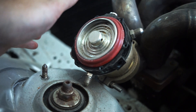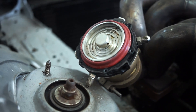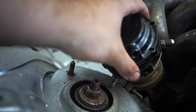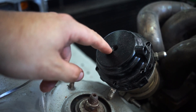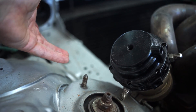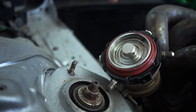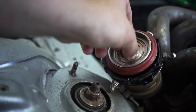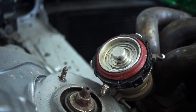Because you don't want any excess pressure that can influence the opening, you want to leave at least one of the ports in the top open so that it works properly. There's also the possibility to put in a screw to give the wastegate some pretension and limit the amount it can open, but that's not really something I would recommend. So that's the external wastegate — I'll also explain how it works with a three-port boost controller. But now let's look at the internal wastegate.